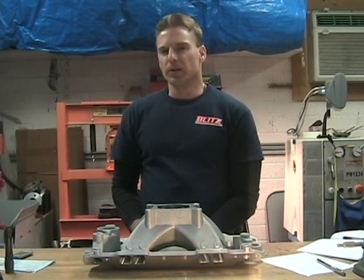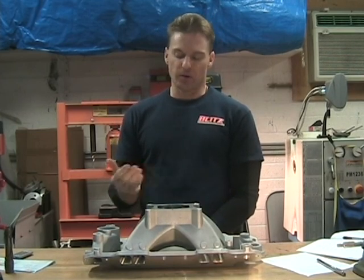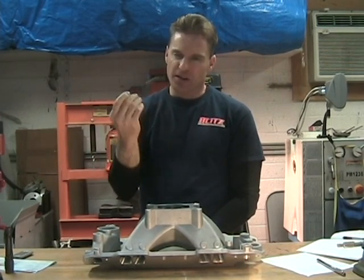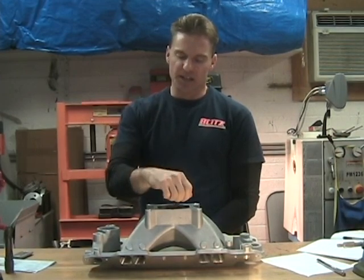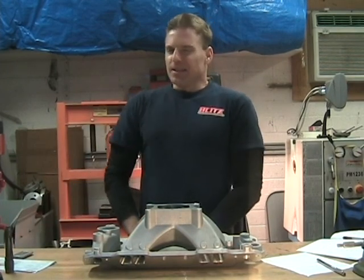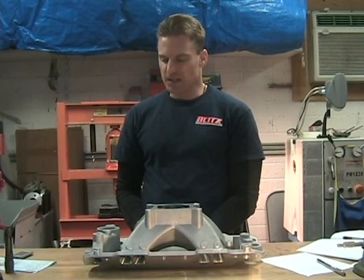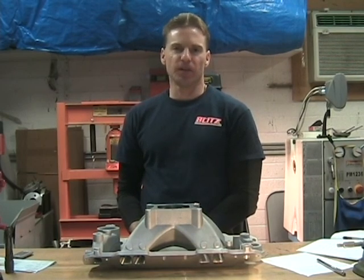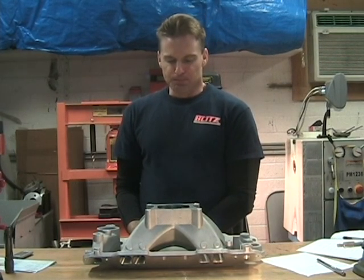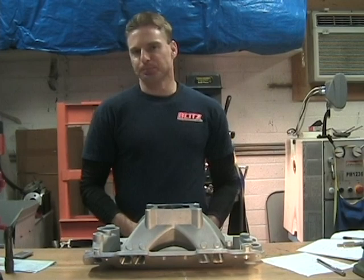If you consider doing this, you may just want to go into the bowl with your 80-grit, or you can take a 40-grit sandpaper like this one here — it'll pretty much knock out the casting flash. Then come back in with your 80 and clean it up. Like I said, three to four CFM for grinding it down may not be worth your time. Depending on the build, if time is money, I may not bother with that area and just clean it up with sandpaper.